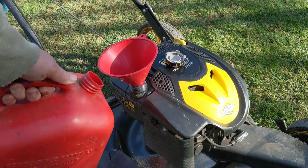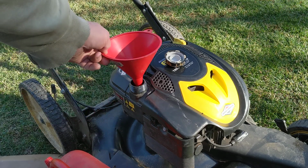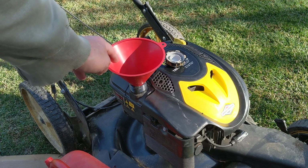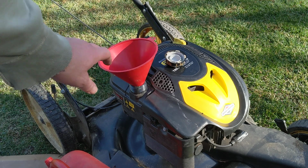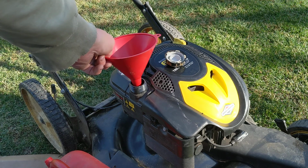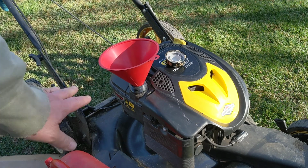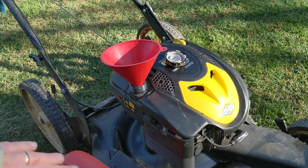You don't want that. Another cautionary note, this gas tank on this thing, that's only the size of a can of pop in there. Hardly any volume to it, so it fills up super fast. So take it easy when you're doing that. Put in a little bit and then pull the can off. Maybe pull that out, have a look in there, see where it's at. Maybe give it a little bit more and do that a couple of times, and call it quits. It doesn't need to be full. You can always put in a little bit more later.